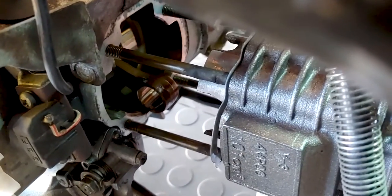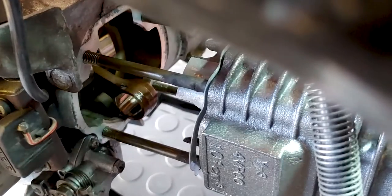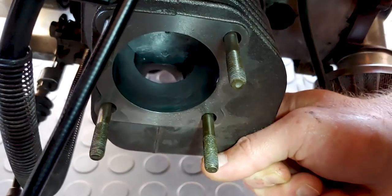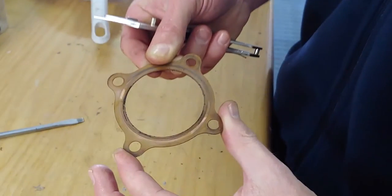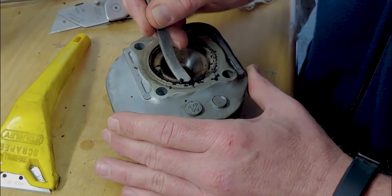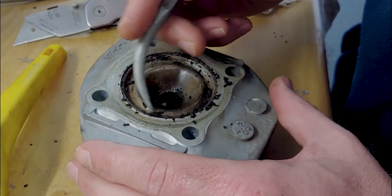Good news — there's the new fresh barrel and piston on, it's really on. We're now coming around to the right-hand side to mate the con rod and piston. Once that's done, we'll give the head a good clean and then reassemble. New barrel and piston is in and it's smooth sailing — look at that, beautiful. The arrow is pointing to the exhaust port as it should.